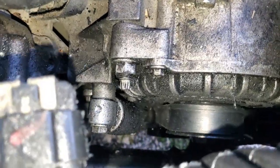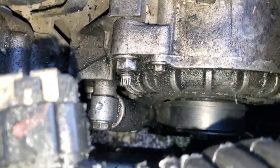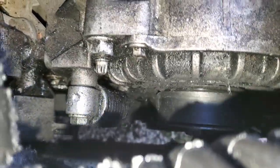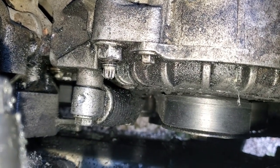The reason these belts keep popping off on this car is because of pulley misalignment, and another reason being chemical deterioration of the belt caused by a large oil leak coming from the front main seal, as you can see with all the oil splashed all over the engine bay.